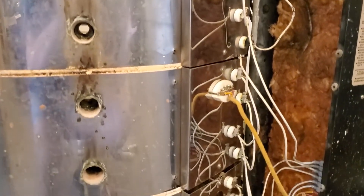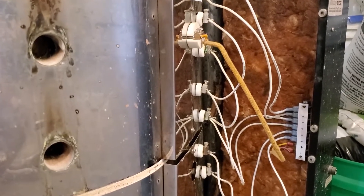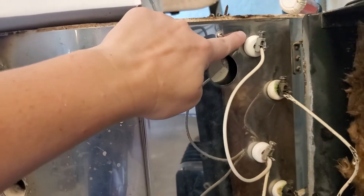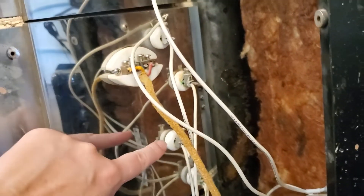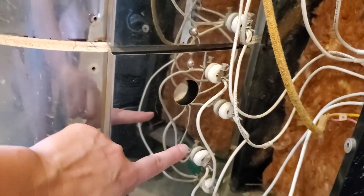You can see there's all these little ports that hold on to your elements, and then they feed in to the computer where you see the blue wire sticking out. All the ones on the left side would be your one and one and your two and two. So this is one straight down to one, and then that wire will come down and be your number one down here. The ones on the right is your two and two — those are the ones that burned up on me. So you've got your three and three, four and four, five straight down to five, six straight down to six, and then they feed right in in order over here.